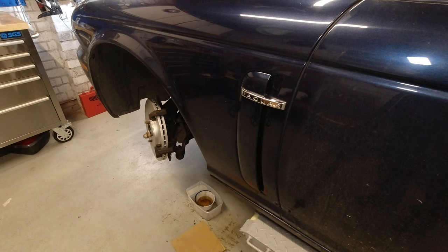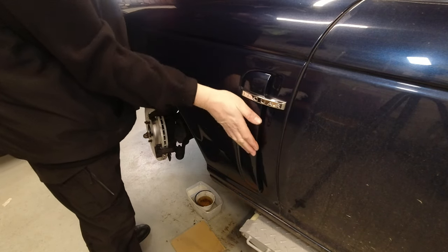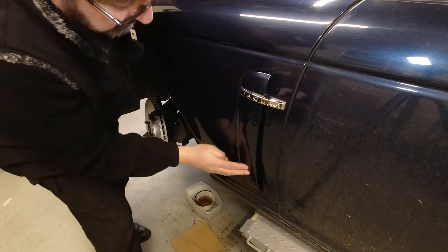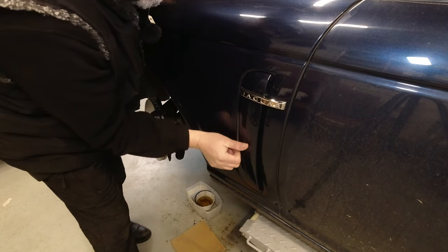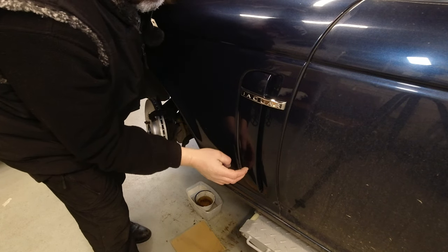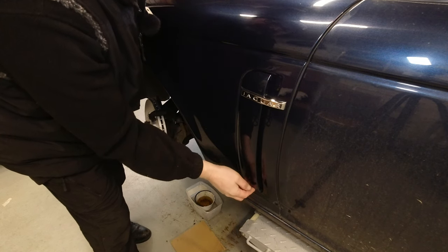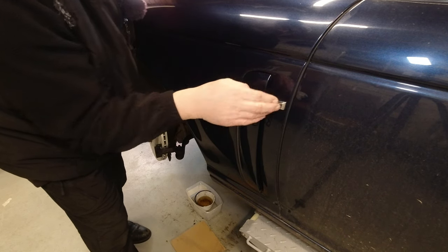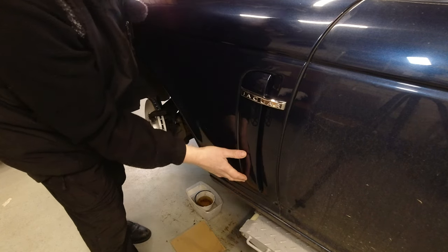Okay, so those panels are now clean, dry, and I've warmed them up considerably using my hairdryer. So they're actually summer day warm now, rather than the rather cool temperature it is here in the garage. I've got the heaters on, so things will improve. Can feel a tiny amount of tar spotting on this, but I don't think it's going to matter because of the way that the adhesive is used on the covers. It tends to be in little strips rather than a whole surface.